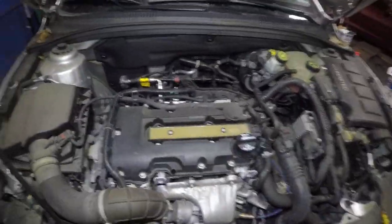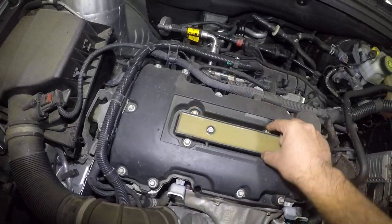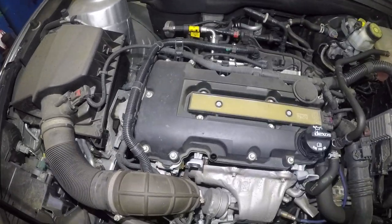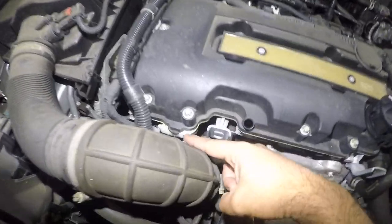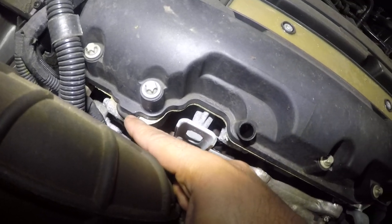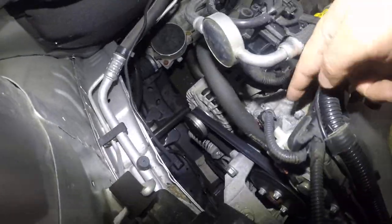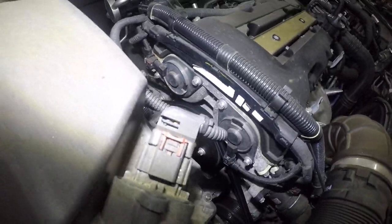What you're going to do is put a new cover on, and then make sure you tighten these bolts in order — try to get these two and these two evenly flush, and then crisscross, just cross tighten them. And that's how you're going to resolve your issue. It's probably going to be like a 40 minute job. Make sure you're not having any leaks afterwards — you see this little bit of silicone right here, make sure you clean that out with the blade, and make sure you put a little bit of new one, because that is what the timing cover is. You're going to have a few more spots of silicone in the back, probably over here. So make sure you put a new one in and make sure you line the gasket really good after that.